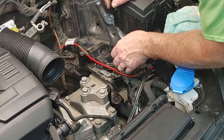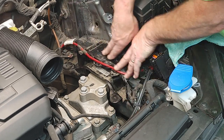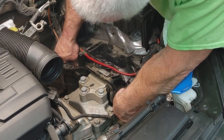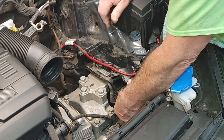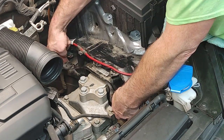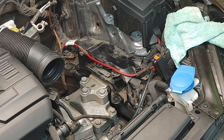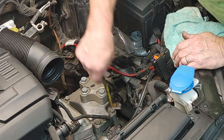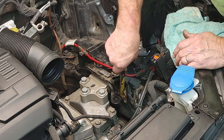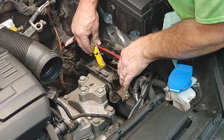Okay, so I'm back. So what I found is that the mount that holds this wiring harness up, this plastic bridge, it's basically a bridge. There's like some mounts. It's kind of, I don't know what you would call it, I guess Christmas tree. Some people call them Christmas trees. That's what it looks like, basically. They're like a reverse Christmas tree. And they're just pressed into the frame rail right here. So I just took a little pry bar and I went underneath and slowly just pried up. They came right up. So they're down here where the metal meets the plastic, and this is shaped like a bridge. There's a footing here, it goes up, this is the top of the bridge, and then it goes down. You just pry it up. So this all came up.